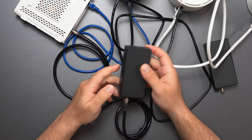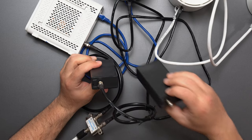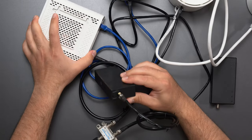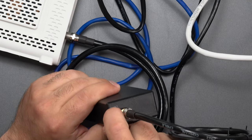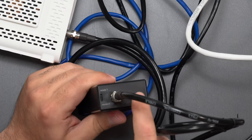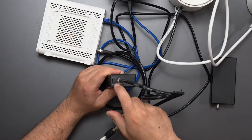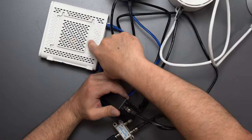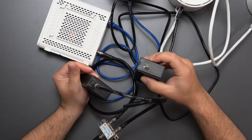Specific to this unit — this is the Asus MA25. If you have a DOCSIS 3.1 modem, which most cable modems are, you want to run this MoCA adapter in mode 1, not mode 2. If you're running fiber optic and already have ethernet, you don't need MoCA since you already have wired backhaul. But if you're on fiber and need MoCA, you would run both adapters in mode 2. For this example, since we're using a cable modem with DOCSIS 3.1, set both adapters to mode 1.